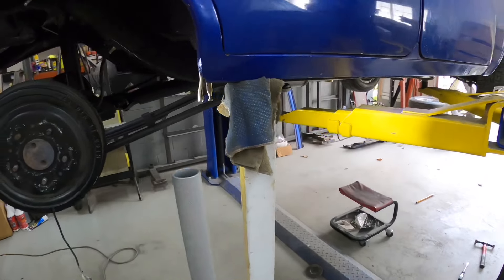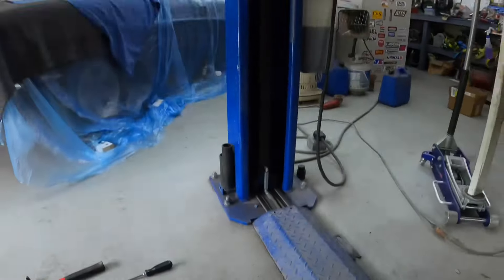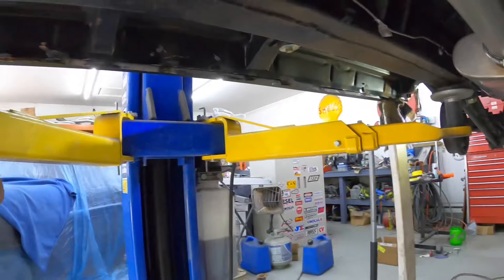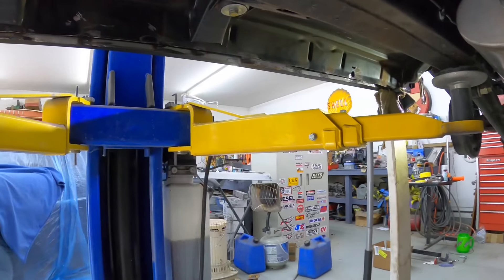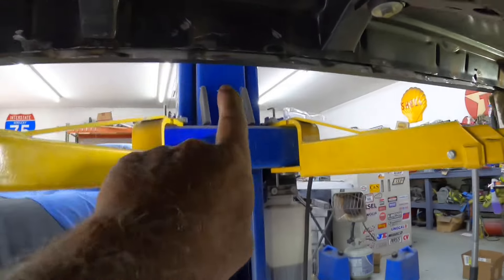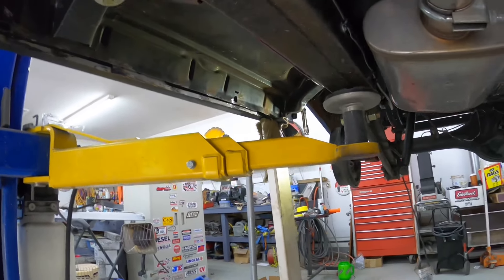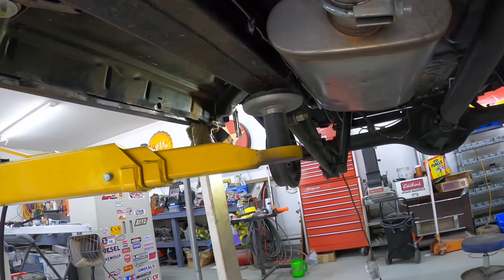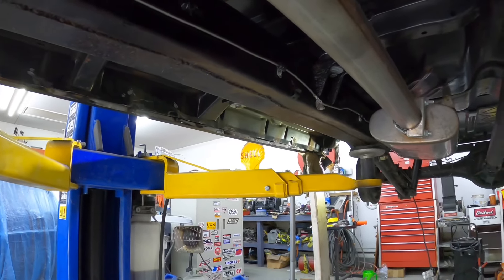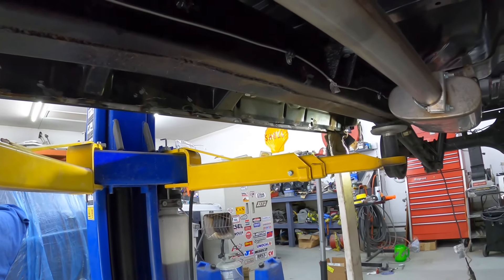We made some headway. I cut away all the welds off that, and we started to lift it up at that point. Now we need to start lifting the actual body through here - it's got sort of a bow in the body, so we need to progressively lift it up so this is in line with that. Already a big improvement. We just lifted up the body to where it's supposed to be, roughly. It's very close, but it's got a belly in the middle so we've got to lift that up too. Get that right and then we can start working on the back.